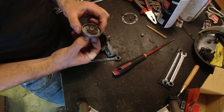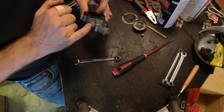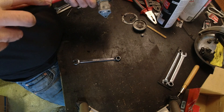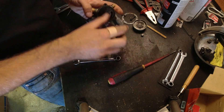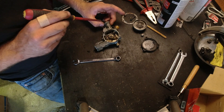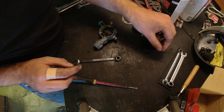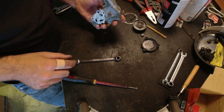I felt that that was engaged in there, so that is good. I felt that they've moved — this thing has gone in about thereabouts. I've turned those a little bit more in order to hopefully get the chokes to turn off a bit faster. This is just a summer car, so if it has a tiny bit of difficulty starting in winter, you might need to hold the throttle a bit — I don't really think that's a big deal. What we want to get to is there's a needle in here that meters into a jet, and that is the enrichment part. There's no o-ring on there, and I do have a spare one. This is the old one from the other side — they're tiny little things, and if they leak, even in the closed position fuel goes out.